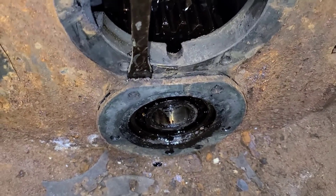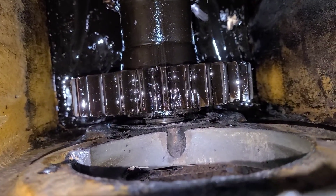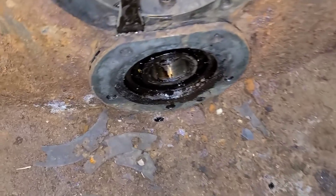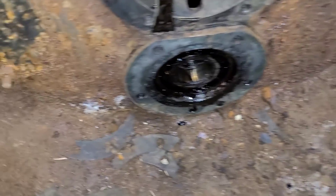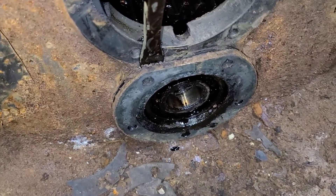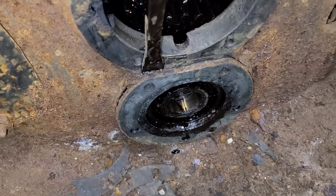So by driving that shaft back, I was able to create just enough room in there to get my slide hammer on the back of that lip with an extended finger and just get it started. I've got my pry bar in there just holding it — let's work that pry bar to get it out of there, just like we did on the top.